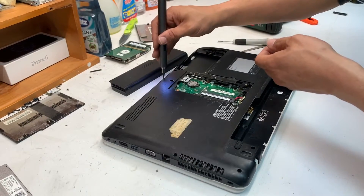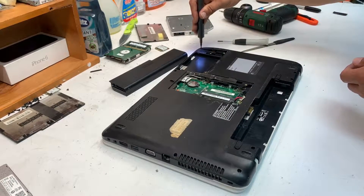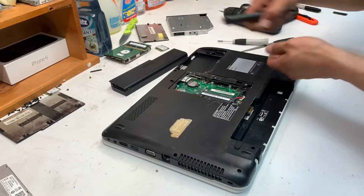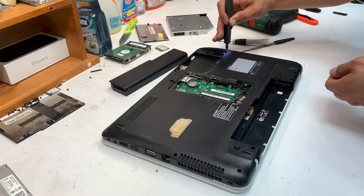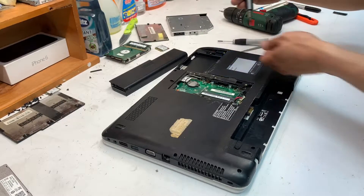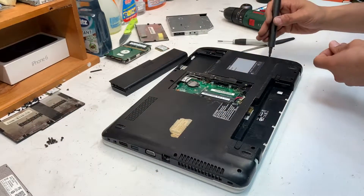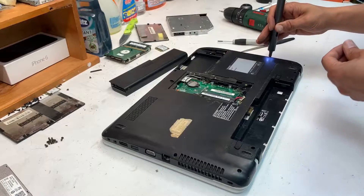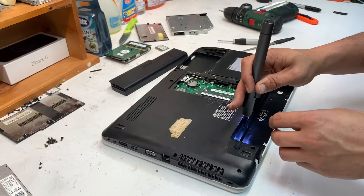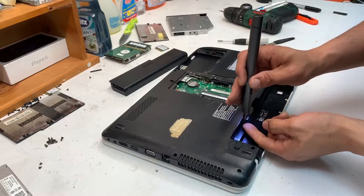The reason you need to do fan cleaning once in a while is that the fan vents and ventilation on a laptop are so tiny. If you leave it in a dusty area, even small quantities of hair follicles or dust accumulate in the vents. The blockage speeds up pretty drastically from that point — it takes a while to initially block, but once it's blocked, further blockage becomes even more imminent.